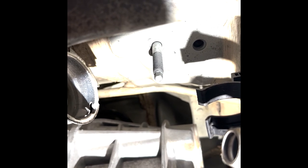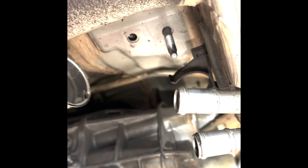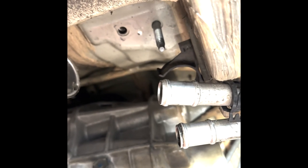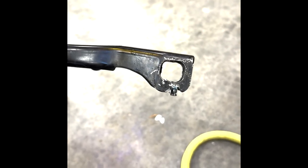One thing you have to do is relocate the mount brackets — there's a stud that comes out. That stud can be moved back to a mount point which I believe is for the Tiptronic transmission. The head of that stud is seven millimeters. After a bunch of trial and error, it does work: you can just notch it and it will fit.